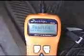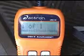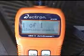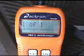Once you do that, be sure to turn the vehicle to the on position. Not the start position, but the on position. This is going to give you the correct codes. Then you hit the read button. It'll send the data to the scanner, and it gives me a P0141, which tells me that this is the O2 sensor that's having the problems. You can look up this information and these codes on the internet.